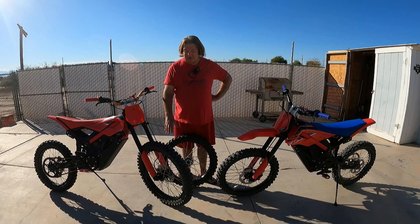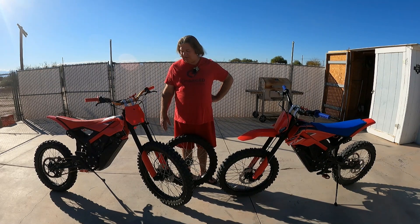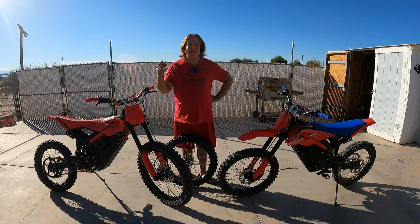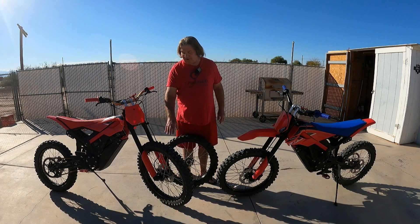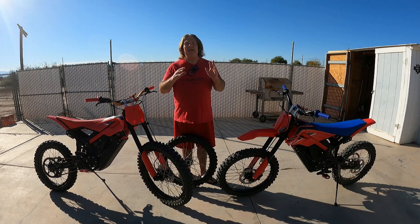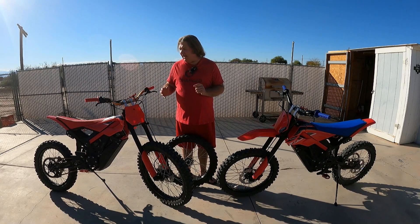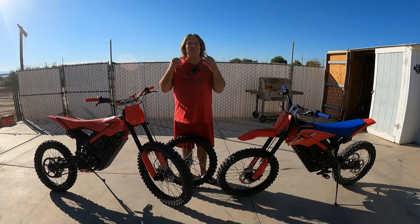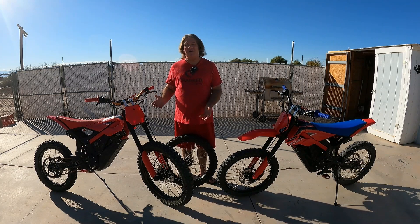So if you really want it done right away, you can order a Warp 9 or any 21-inch rim with 36 spoke holes and send it to Buchanan Spokes and they'll do it for you. Here's the good news: Warp 9 is going to be bringing out a complete ready-to-go wheel for these with a 220-millimeter rotor instead of the stock 210s. That's going to be available sometime probably towards the end of January or early February. They're going to start doing sprockets for them too — just keep calling Warp 9 and bugging them, because if they see there's demand for Beta parts, they're going to start adding more.